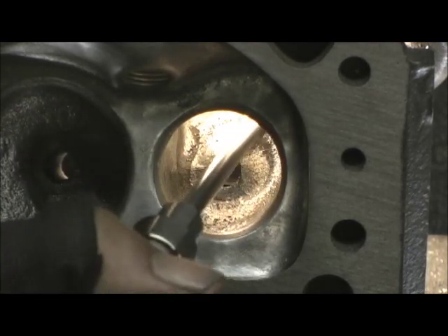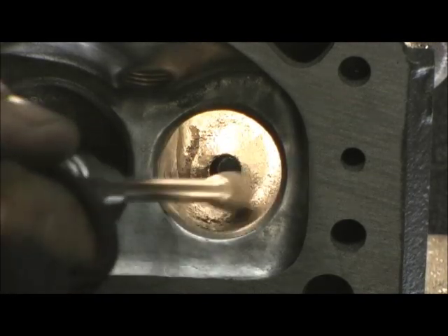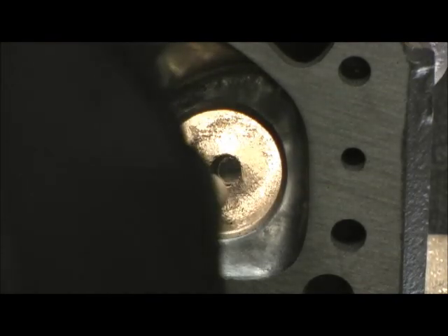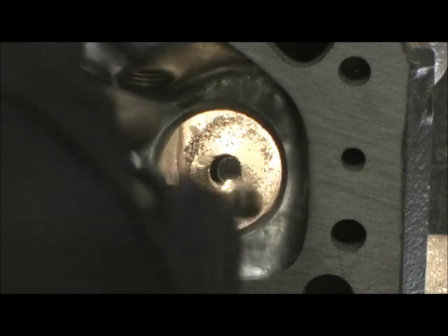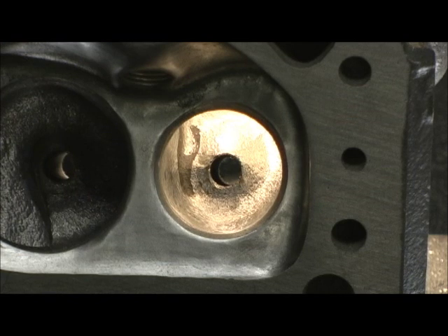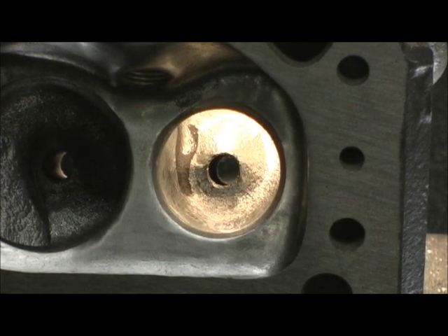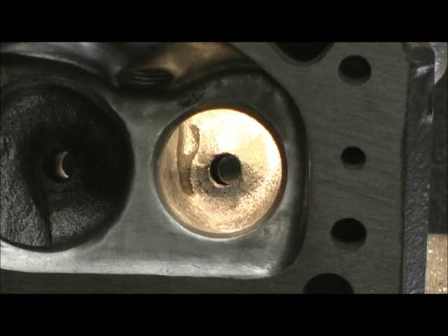If I had to say this about porting, it's all about which shape to use. So far we've used three different ones and there's a ball on there too. It's all about choosing the right shape cutter with the right cutting radius. We'll go more into that later. Look at it — that is absolutely beautiful. She's pulling in really good. That ought to kick us quite a few CFMs on that exhaust. That other side, like I told you, I'll have to go in there and use a different cutter.